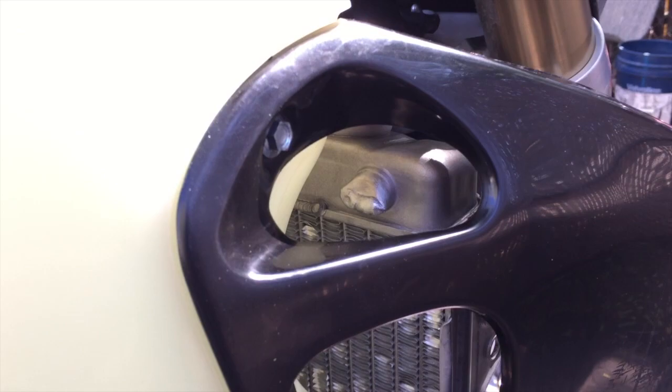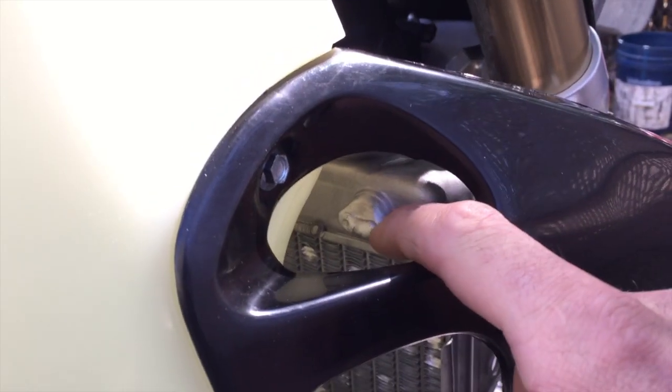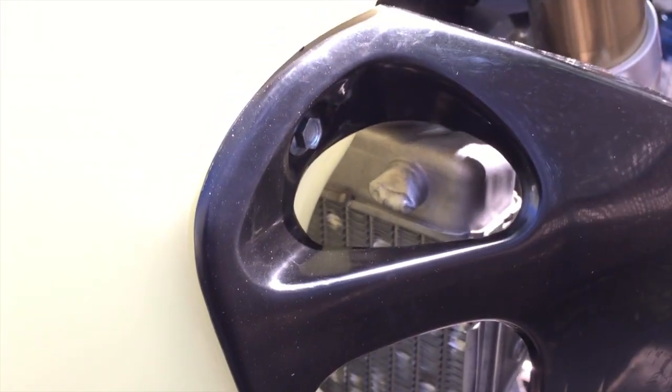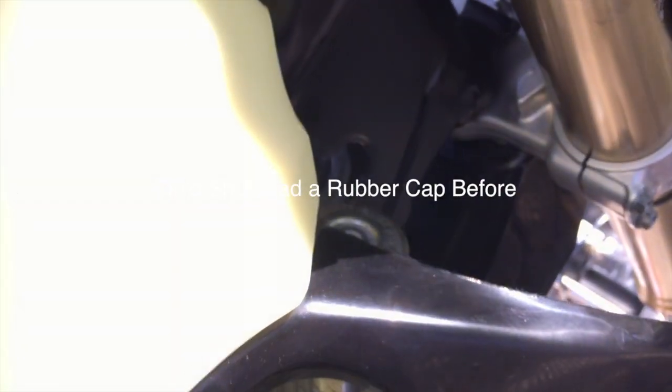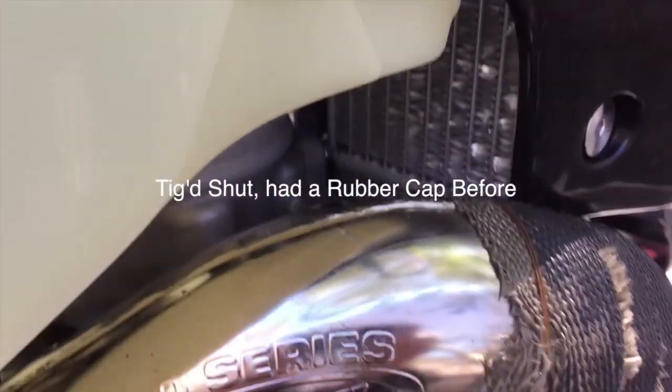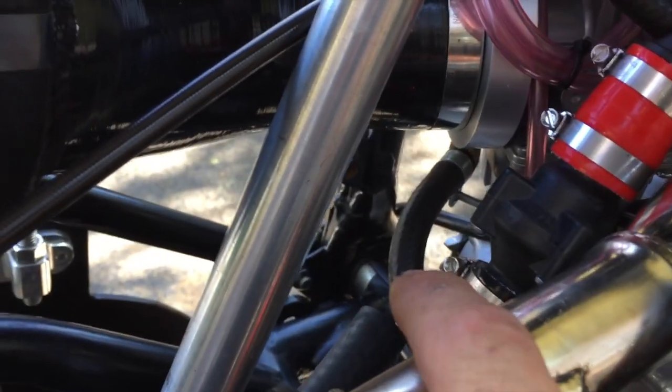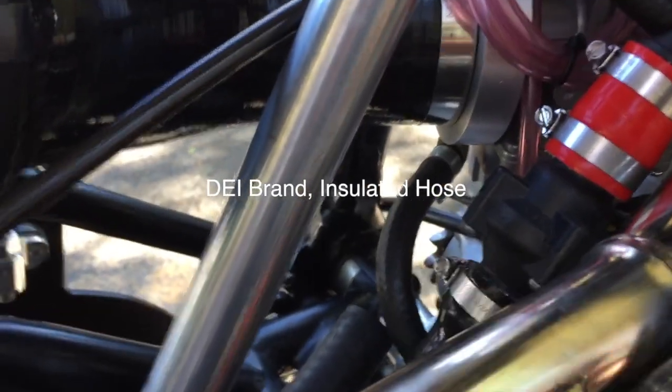The radiators don't even do anything — this bike has a tunnel cooler. The top inlet where hot coolant normally comes in is capped off, so this side just acts as a tank that holds the radiator cap. The water pump pumps cool coolant into the head, it comes out hot, then goes to the thermostat. Before the thermostat is a bypass into the carb heater so that way the slide doesn't freeze, and then that goes back down into the cool side hose.